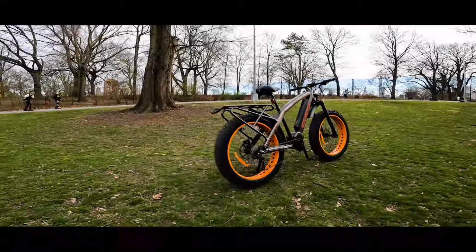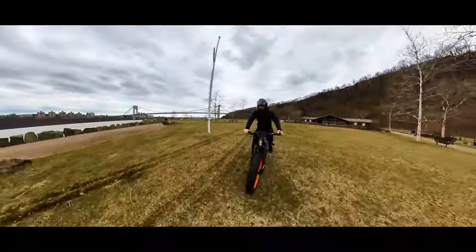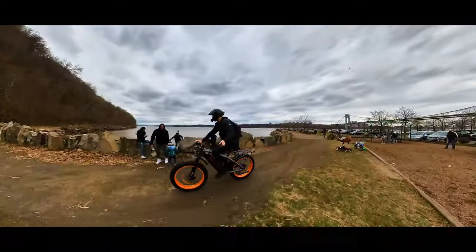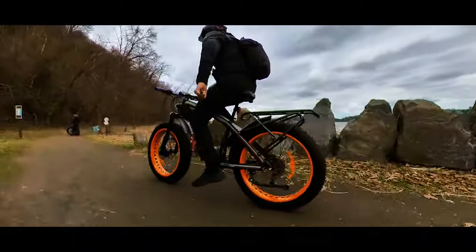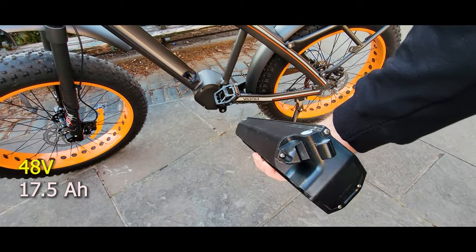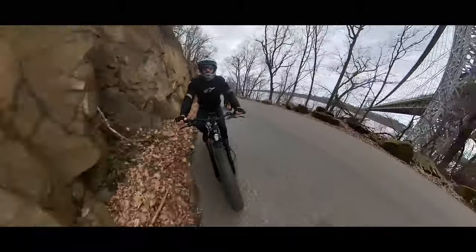The Wild 10 model comes with a rated 1000W BBS-HD Bafang motor with a maximum output of 1638W and 160Nm of torque. This motor can be run at 48V and 52V system — useful if you want to DIY and swap for a bigger or higher-voltage battery to reach motorcycle speeds and range. The battery is 48V with 17.5Ah capacity, containing lithium Panasonic 35GA cells rated to 800 cycles. The controller is a Bafang set to 30A discharge rate.